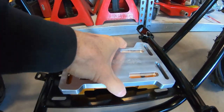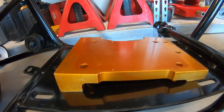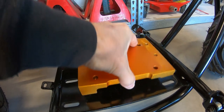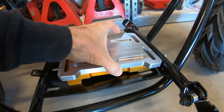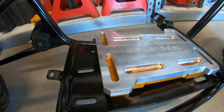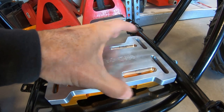Megamoto build part 4. So instead of buying a riser mount for this bike, I think I'm going to use what I have laying around here. I have this 7-degree cart riser plate, which I think might be enough to raise it up in the back to clear the carb on the frame. And then I'm going to stack this custom mount on top of it, so that way I get the front-to-back adjustment and the side-to-side.